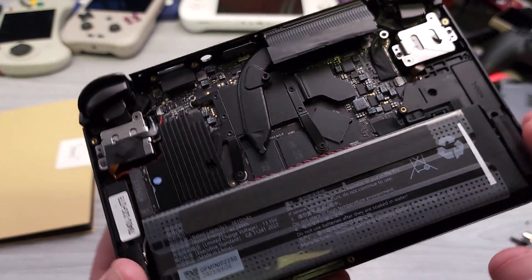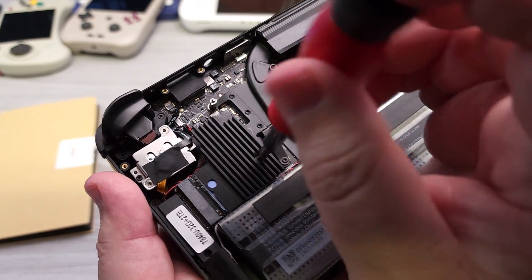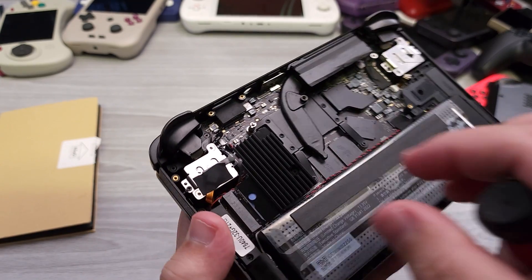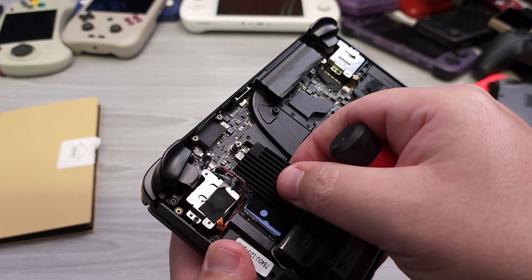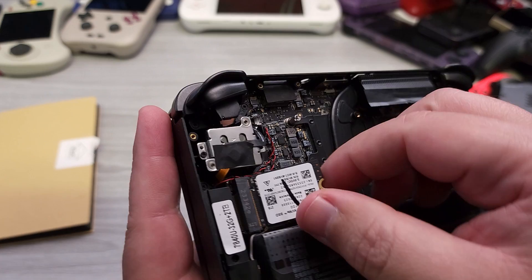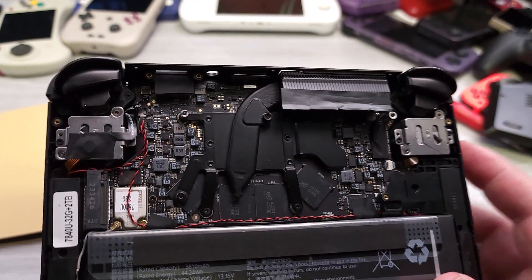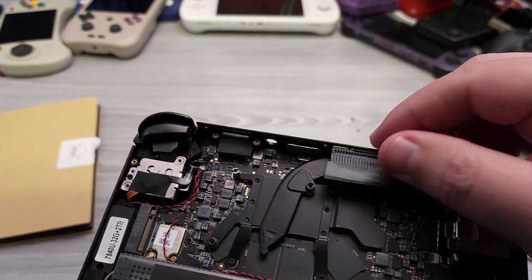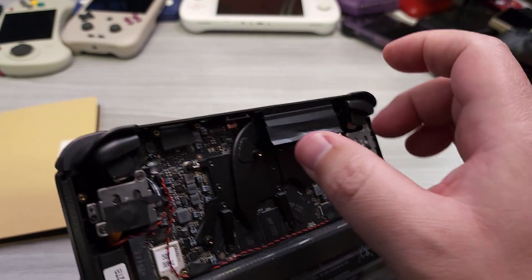I can remove this while recording through the viewfinder. Look at that — the SSD comes up all together with the heatsink. The entire heatsink is coming right off. Here is the heatsink itself with a little bit of thermal tape, and here we have the 2230 drive. At this point we've removed everything that was blocking our way. There are four screws holding the main heatsink assembly — we'll remove those and take off the heat pipe with the fins.